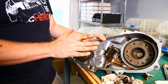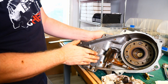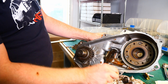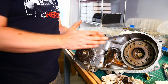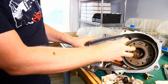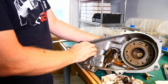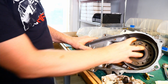it won't stop in the proper place. You may get it close just by feel and by the numbers up there, as long as this was adjusted right in the first place. But really, if you don't feel those stops, then this really should be serviced before you have it partially adjusted and it wears out the — there's urethane pads on your shift fork that rides in here and moves the gears back and forth. When those are worn out, this takes a little bit further, so you would have to go and shift past and then back to get this to all line up correctly.